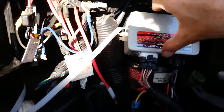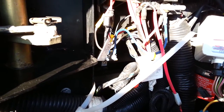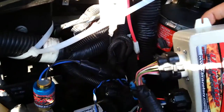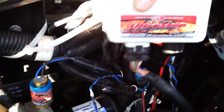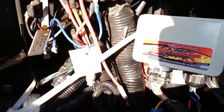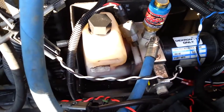I haven't mounted my box yet. I've found a spot underneath but I'm going to turn it around, because I always want my connections to be hanging down. You never want something like this upside down where water can get in and stay. I'll get it mounted underneath in a good spot to keep any moisture out and keep everything dry. All in all, it was a good project — just a couple of hours, no big deal. Just got to clean up my wires.